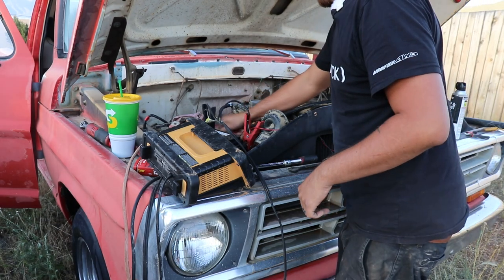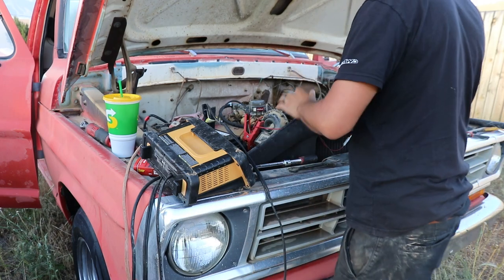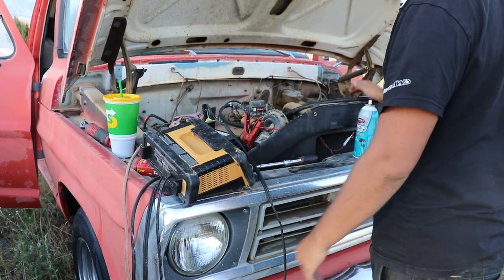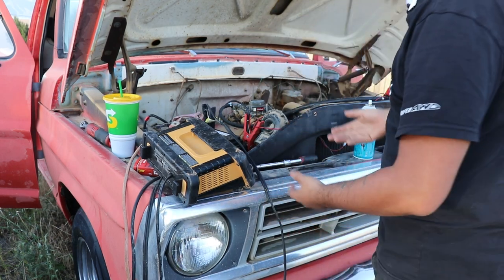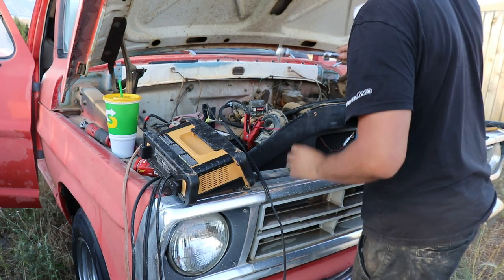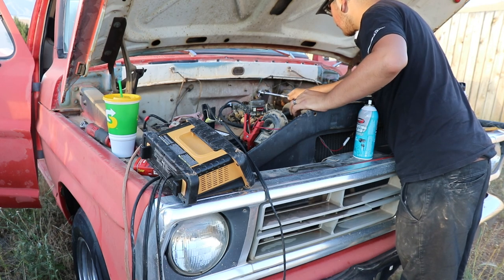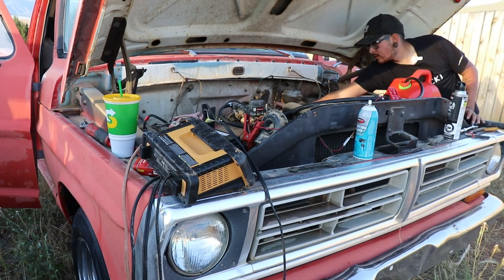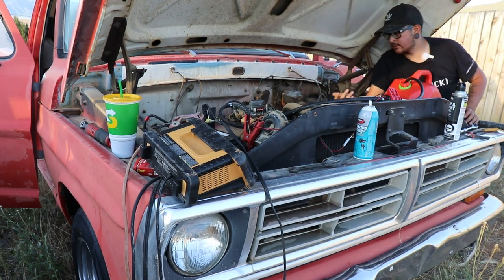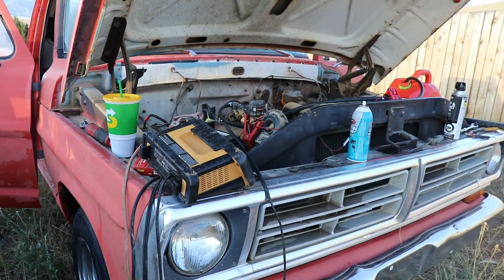Oh. All right, we got fuel coming out of the carb, but oh my God, did you guys hear that? God, that's crazy. It fired. Obviously, the carburetor is just blocked up. I might be able to free it up a little bit or something. I think I overcame the float bowls with the pressure of the fuel pump. So I'm gonna give it a couple little taps here. See if I can free up anything. Seems like the linkages are just what's messed up. Yeah, I'm kind of excited now. Let's try that again. Give it some squirts.